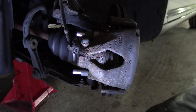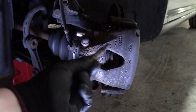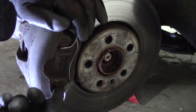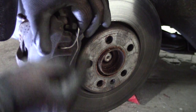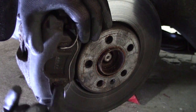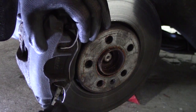You don't have to pull them completely out. On the front side of the caliper there is a retaining clip you need to pry off — right here. Don't push it around these corners because you will bend the clip. You need to pry it from behind, like here, with an old screwdriver.